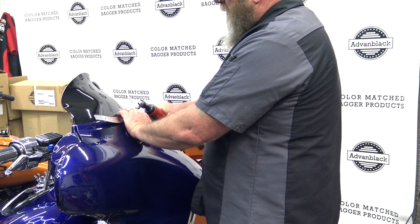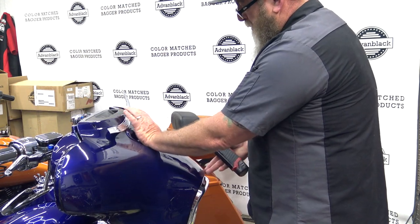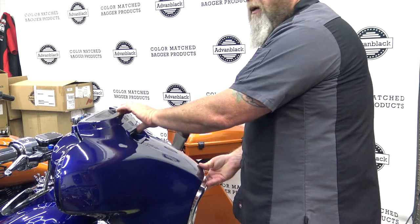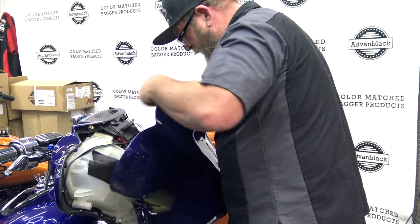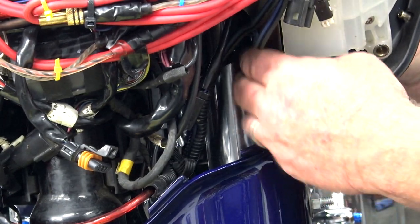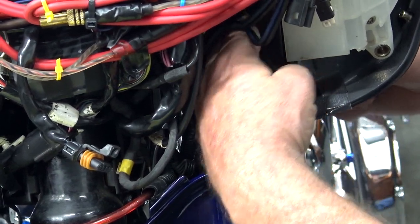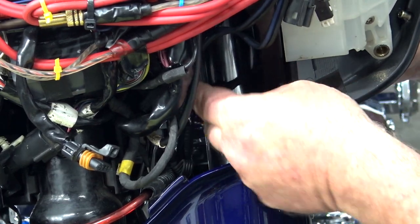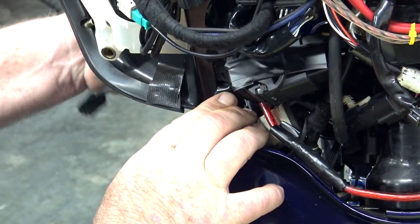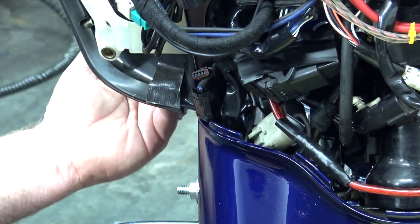We're going to loosen the long bolt in the middle, then hold the front fairing and pull our windshield out, making sure that we maintain forward pressure on the fairing with our hand. Go ahead and remove the bolt, then tilt the fairing slightly forward. Reach in and disconnect any other lights and our headlight. From here, we want to push that adapter back through the hole on the side of the bike, reach in and fish this wire through, leaving the female clip on the outside but accessible from the inside on our splitter. Do that on both sides of the bike.